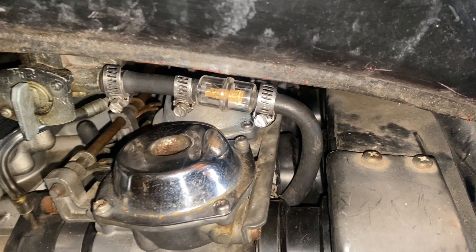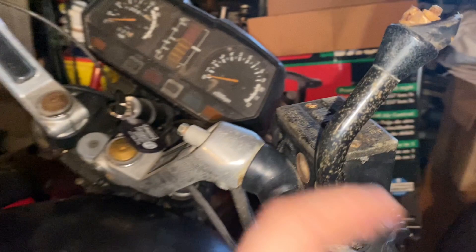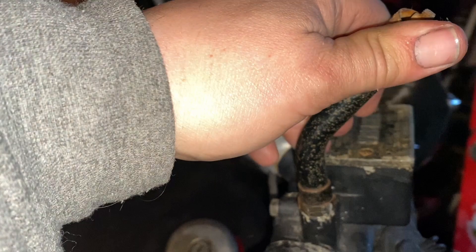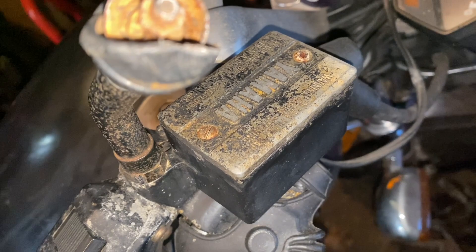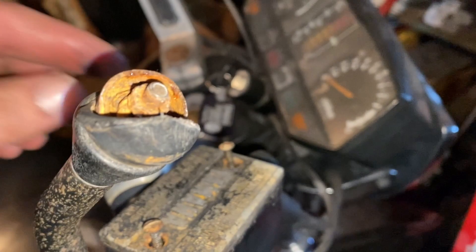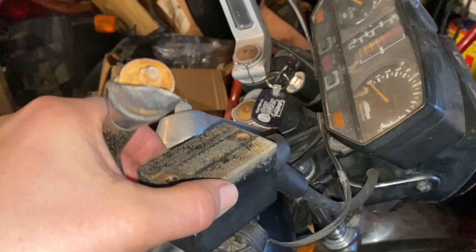All this is up on top so I can see what's going on and hopefully we're good to go. Now we're going to go into this — I did wipe it down a little bit, got all the grime off the outside. We still have to get this off — I'm gonna have to heat this with a torch, but for now it's just in the way. Anyway, we're gonna get this master cylinder off and it looks like we have some weird bolts — there's a Phillips and there's a flathead on this side. Let's hope they come loose without too much effort and we can see what grime awaits us. Amazingly enough, even though I had to use two different screwdrivers, they both were perfectly willing to come off. There's my screws — let's not lose stuff this time.